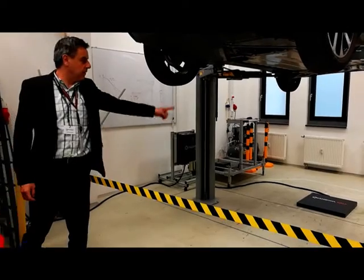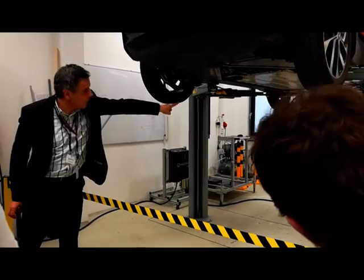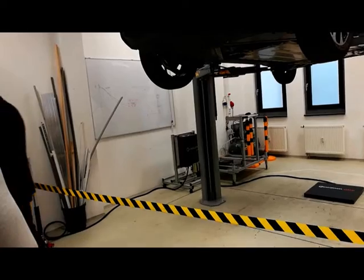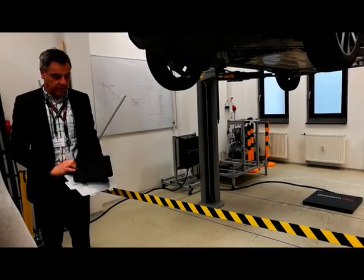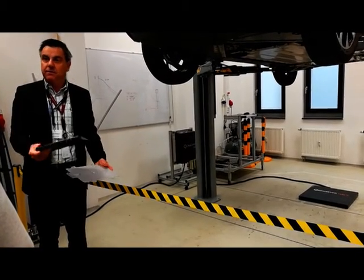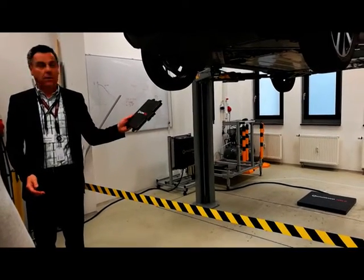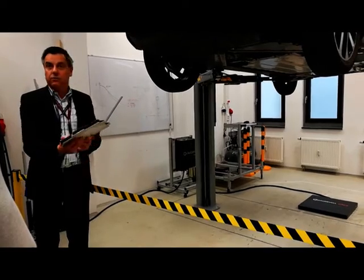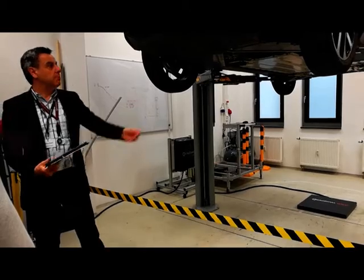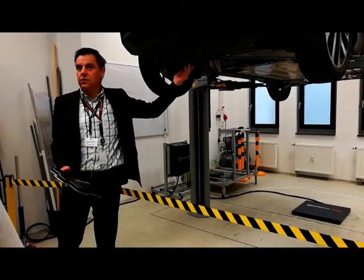In this case it's 230 volts and it transfers to 85 kHz — that's the operating frequency — and it transfers power into the vehicle pad you see underneath. That's a small pad, about this size, and inside you can see the coils plus ferrites. That's a completely passive side. In addition to this vehicle pad or secondary coil, there is a rectifier, which converts the AC 85 kHz signal to DC current to charge the battery.